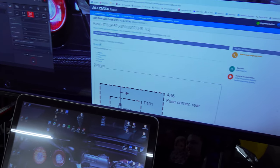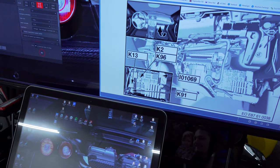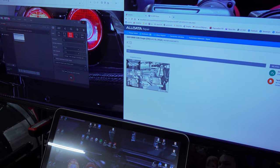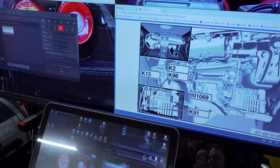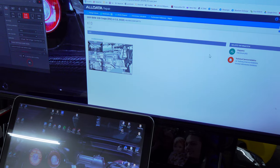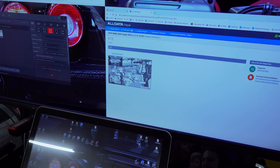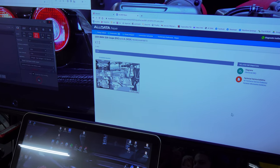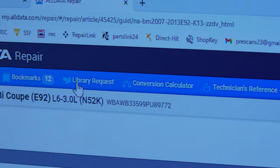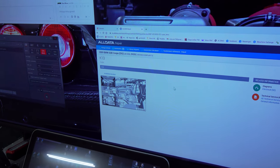Let's go back to fuse 47 — the top one. I'm pretty sure it was completely identical. I'm going to have to hook up the OE tool and see what the correct relay is, because it looks like we have the wrong relay. If I would have ran with it, this would have led to unneeded replacement of a junction box module. Service information is critical, right-to-repair is critical, and service information accuracy is critical. Those of you who don't have the factory stuff can always hit Library Request and ask All Data to correct the information.